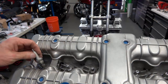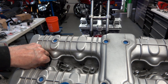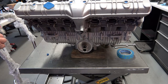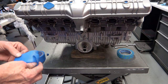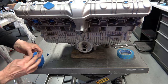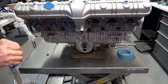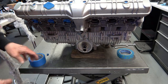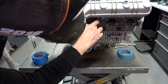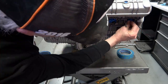I'm showing here how I tape up the holes so that the paint doesn't go down inside, and then I put old spark plugs that I don't care about in to cover up the spark plug holes. After the engine's painted I'll replace those spark plugs of course. On the exhaust ports I just ball up blue tape and stick it in there loosely - it really doesn't matter, even if paint got in there it would burn off immediately. I still plug them up anyway.